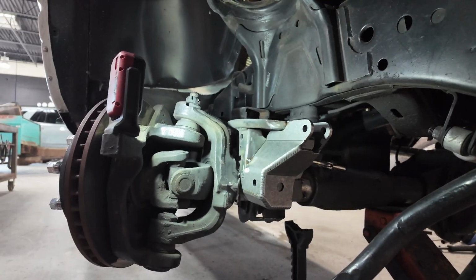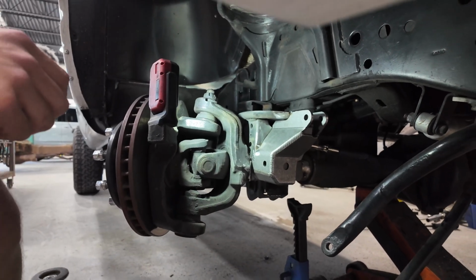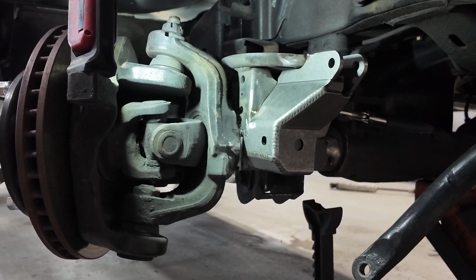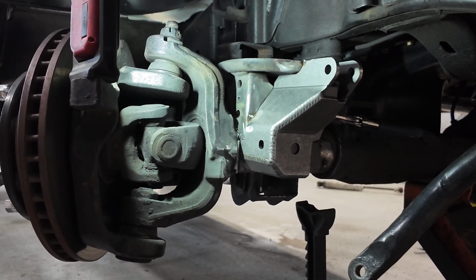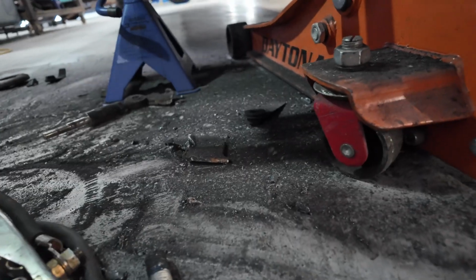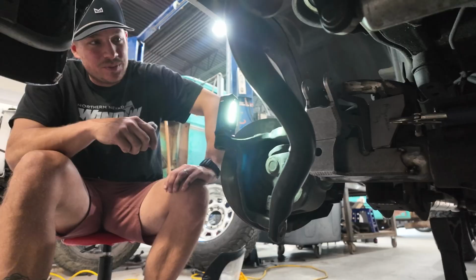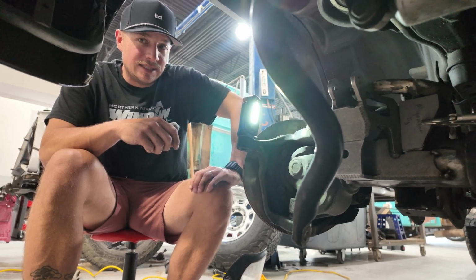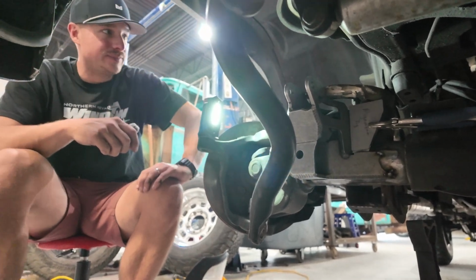Well, after quite a bit of cutting and grinding, they weren't lying in their instructions, we got this piece to fit up pretty square. I mean, we know it's not going to be perfect because there's just variations between different trucks and how we cut off the mount compared to how they cut it off, but it sits very nice and square. They did give us a little alignment jig on this side. Put that guy up with some vice grips and got her pretty squared up. We are not going to weld anything until everything's mocked up, because I've been there, done that, and I hate cutting metal.